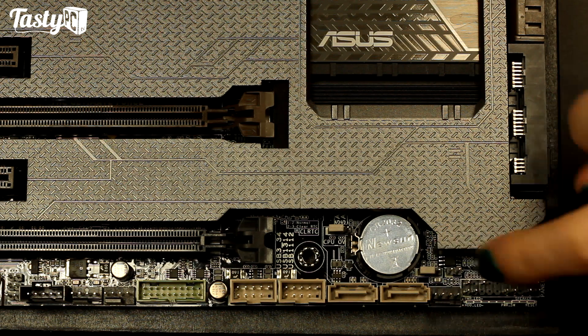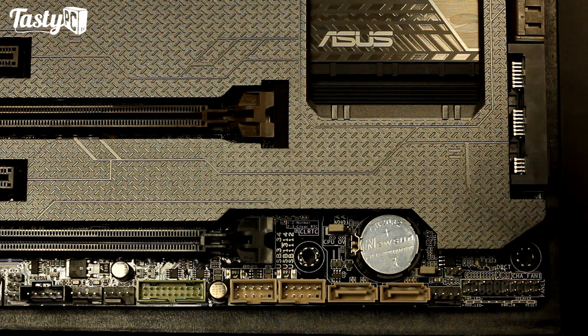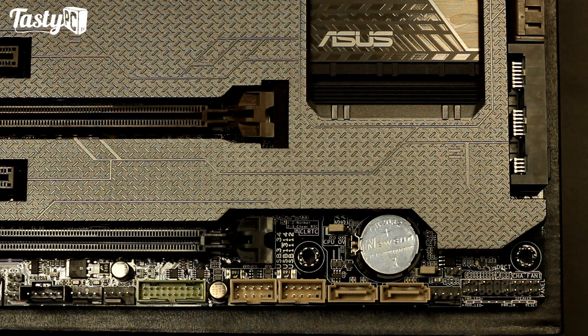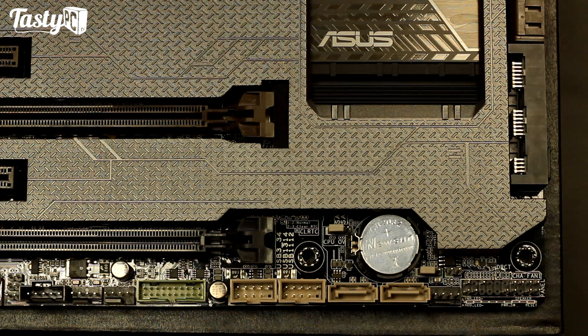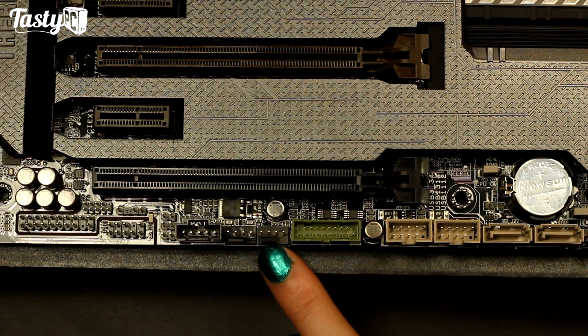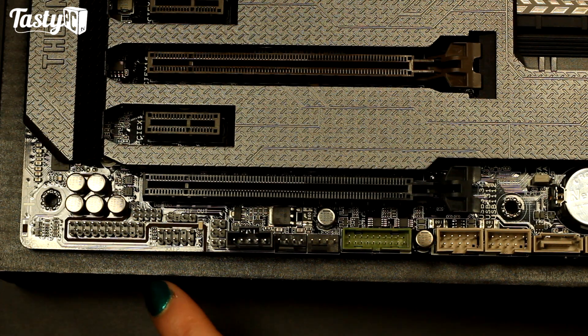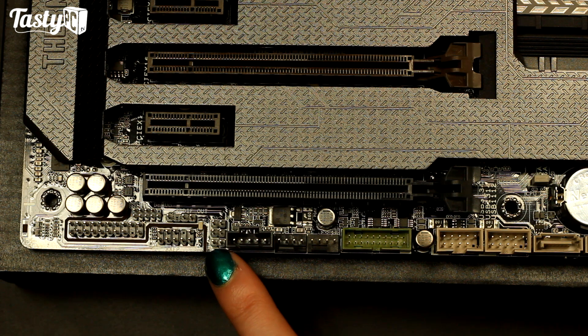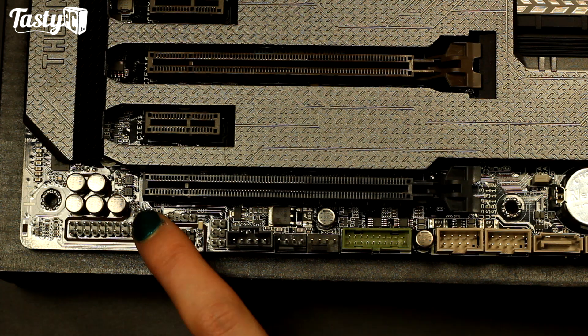There's also a clear RTC RAM header which you use to clear the real-time clock in the BIOS, essentially the same as clearing CMOS. There's a CPU overvolt jumper for extreme overclocking, the BIOS battery, another 4-pin PWM fan header, two USB 2.0 headers, and a straight USB 3.0 header — so in total this board can power four USB front connectors. There's also a Thunderbolt header and two more 4-pin PWM fan headers, giving this motherboard six 4-pin PWM fan headers in total. There are also three headers for the temperature probes, a front panel audio connector, a digital audio connector, a trusted platform module header, and an LPC debug header.